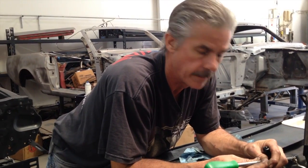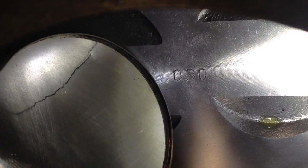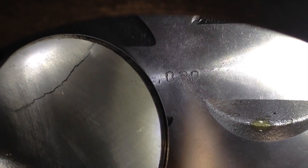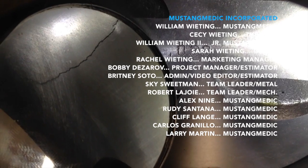We inspected it and we definitely found a problem. We'll show it to you in just a second. Okay Tony, we inspected everything — we inspected the deck head and the cylinder wall, and there's a huge crack. Don't know how it got there; the car never ran. Whether it was bored and covered up, now you put pressure on it and it spread. But that's where the coolant's coming from. So we're going to have to pull this motor and get another block for it. And that's where we're at right now.